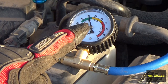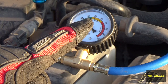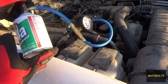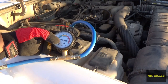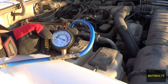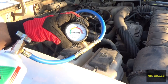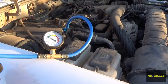With the truck running, you can see the needle drops as the compressor runs, then the compressor shuts off as pressure gets too low, rises again, and the compressor runs again — cycling back and forth. Now I'll start opening the valve to let refrigerant into the system. You can see the needle rising as refrigerant enters. As you add more refrigerant, the compressor runs longer before shutting off. Open it in bursts, and turn the can from 12 to 3 o'clock — you'll feel the can getting cold as it loses pressure into the system.